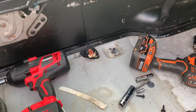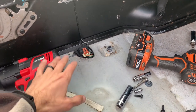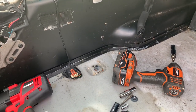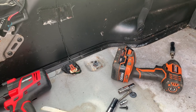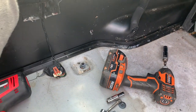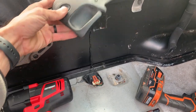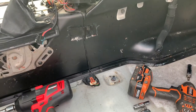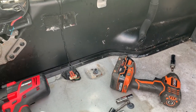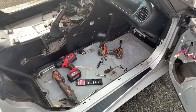I'm probably not going to do it on this car, but there are ways to completely disable traction control by undoing sensors. If all you do is undo the yaw sensor, that's going to disable part of your stability control but it's not going to disable traction control - and that's going to cause a problem for you. So I personally prefer to have the system entirely functional. For now I'm retaining this button, but when I do this build later I'm going to replace it with a momentary switch so I keep the whole system functional and can turn it on and off. Down the road I may experiment with a mod where you can snip a wire up at the electronic brake control module to disable the traction control in the rear of the car, which is the other portion that's necessary.